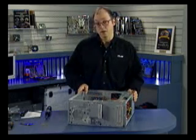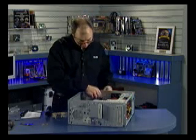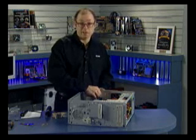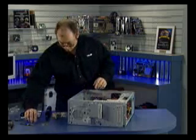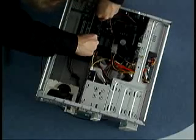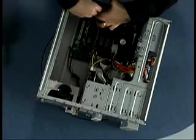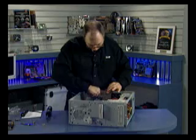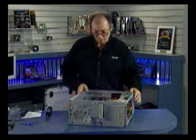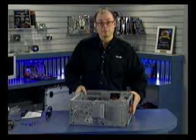The video card is now installed. We also have a network card to install. I'll skip over one slot to leave a little extra room next to the video card for airflow — it's a good idea not to use the adjacent slot unless you absolutely have to. This is a PCI card and it goes into one of the white PCI slots on the board. Simply plug it in and reinstall the screw to retain the card. Now we have our video card and network card installed. Essentially the system is now fully assembled — we just need to add the covers and power it up.